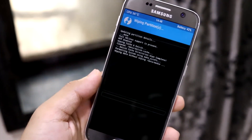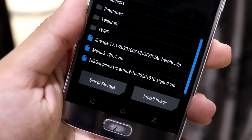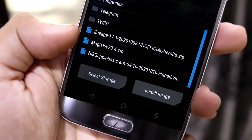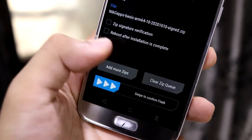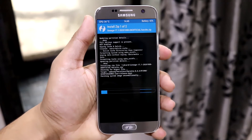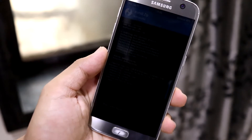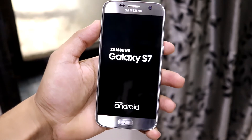Swipe to wipe, then go back to install. There are three ZIPs: the LineageOS ROM, Magisk for root access, and NikGApps — any Android 10 GApps will work, just make sure they're ARM64. Flash the ROM and GApps, reboot, and after it boots you can go back to recovery to flash root if you want — root is optional. Installation is successful; it will boot and show the LineageOS boot animation in about 20-30 seconds.